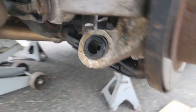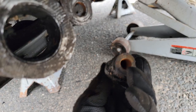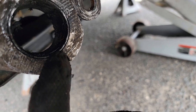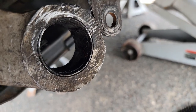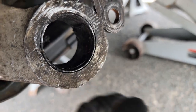Side one done. This was the bushing that was already destroyed. As you can see, this is the metal sleeve that goes in the middle — it's all rubber in here — and then there's another thin metal sleeve we have to cut out. Just be careful when you're doing that with your Sawzall. That's what it looks like when it comes out. Then we're going to lube up the new bushing and press it in right here.